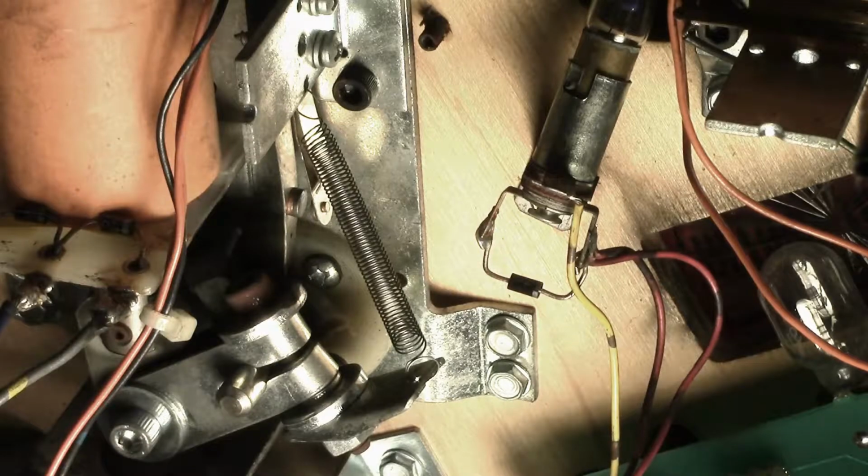Then you have, for the switch matrix, like the targets and all on electronic pinball machines, silver contacts, or contacts that are just signal based. They don't really have any high current or voltage to them. Sandpaper will ruin those, so you don't want to use anything harsh on them. A little DeoxIT with a little piece of cardstock or something like that will clean those just fine.